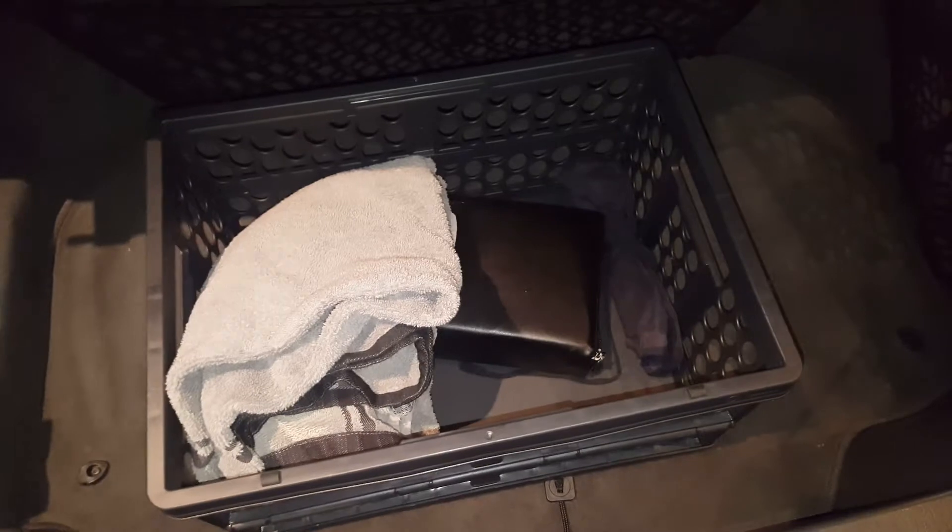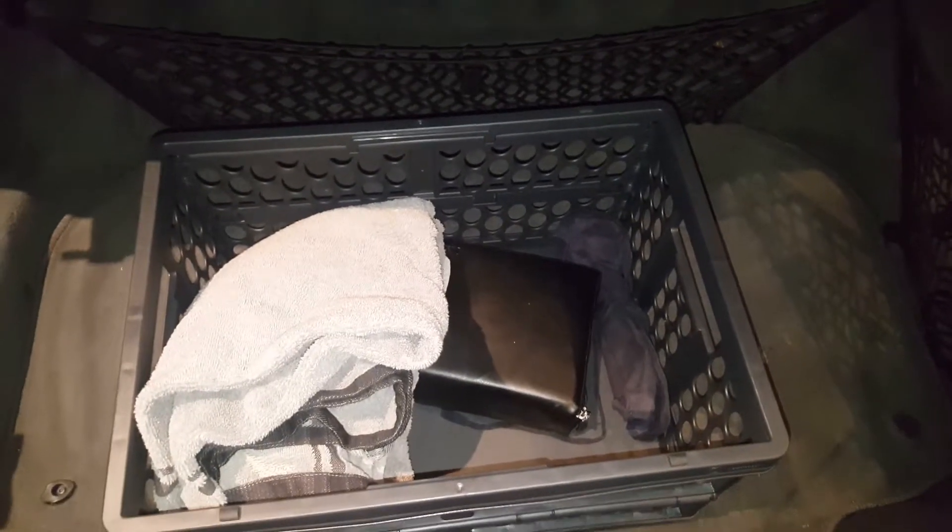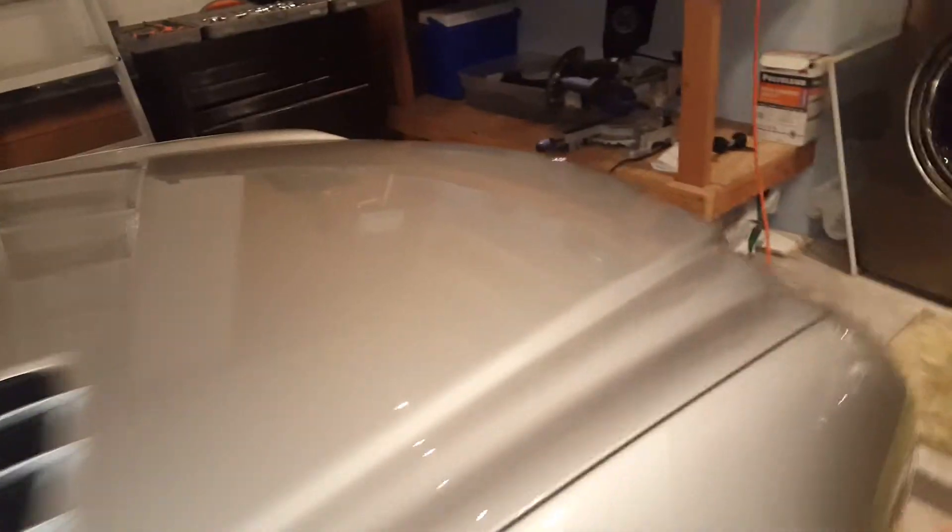This is the back of the vehicle. There is a false floor right here and the battery is located right under that — you can see the trickle charger hooked up. We're going to be putting the amplifier back here, either raising that floor up or building a false floor with a plexiglass top and some vents, directly connected to the battery and running cabling through to the vehicle. We'll run the fifth channel to the subwoofer, the rear channel to the back speakers in stereo, front left and right to the doors, and front left and right positive summed to the center channel speaker.